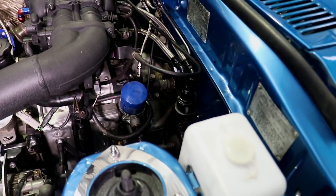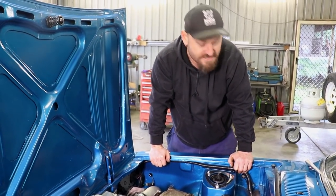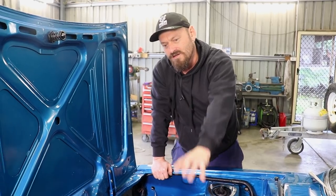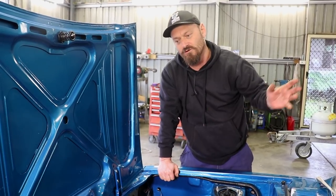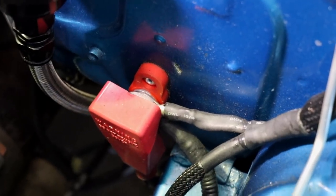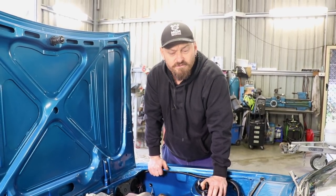I've done a bit of a rewire on the car itself, more just tidying up the factory wiring, recovering it, and making sure everything's okay. It was in pretty reasonable condition so that's all it really required. I removed a lot of wiring it didn't need anymore — the wiring looms for the old 70s rotaries have a lot of electro-mechanical emission control stuff in them that no one understood and is no longer required, so I've removed all of that. The battery's in the boot as well. You can see there's a big bulkhead connector down here — that goes through and connects to the battery wiring inside the car and also to the starter and alternator. They're a great idea; I use them a lot now.